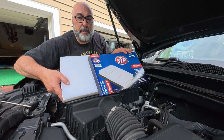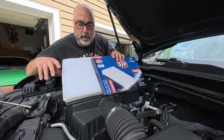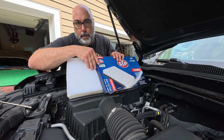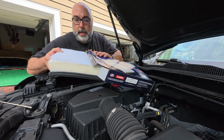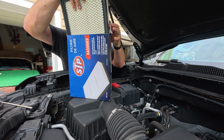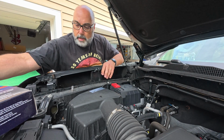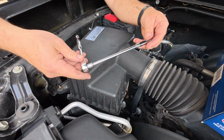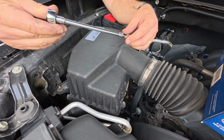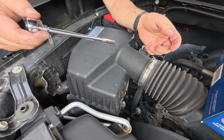And you'll see, because the last time I bought it, they didn't have the off-road compatible one, so I just got a regular one and it does not have this piece. But this should be the easier of the two things we're doing. So let me throw it back in here and let's get this air box off. All right, I got myself a socket wrench with an 8mm socket on it. It'll be easier than using a Phillips head, but I absolutely could use a Phillips head.